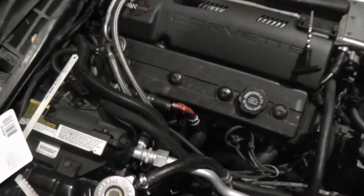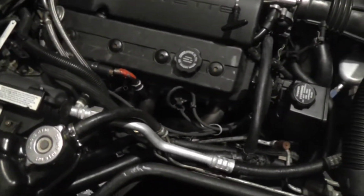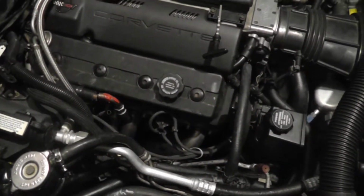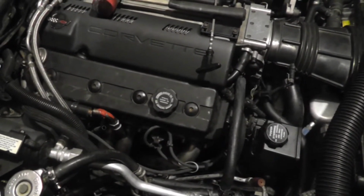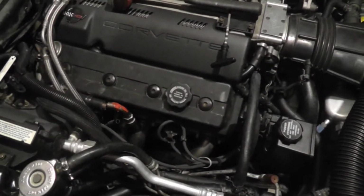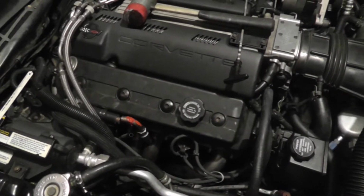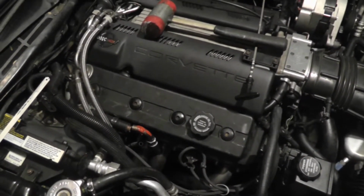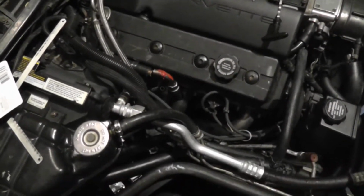Alright guys, definitely it took me about 45 minutes to bolt that on because the threads are really tight, and obviously if they made it a loose thread then you could get an exhaust leak and it would sound bad. So the threads are really tight. I could only turn the wrench, I think, 1/8 of a turn each time, then flip the wrench over to go another 1/8. So I got a 1/4 turn for every 2 strokes of the wrench, which took a long time and it was really hard to turn.